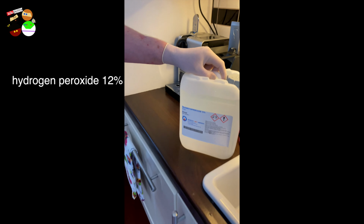So if you were looking for a way to retrobrite whatever you need to retrobrite, and if that's how you came here, we hope this has been very helpful, and we hope we encourage you to go ahead and try this method. Just remember, don't put the temperature too high, and check every 30 minutes. See how it's going. If you're not in Europe, 50 Celsius, I don't know how that is in Fahrenheit, I think it's 130. Something like that, but just to be on the safe side, convert it to whatever you use. We're here in Europe, in Holland. And all in all, the time was 3.5 hours. There you have it.